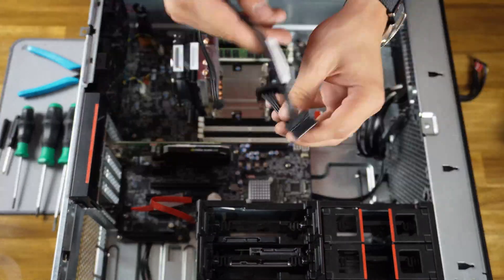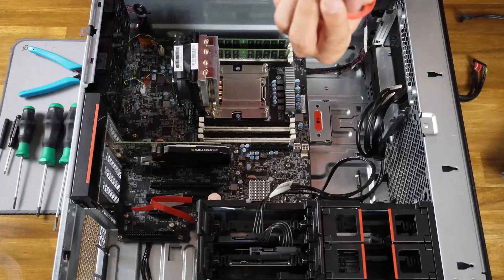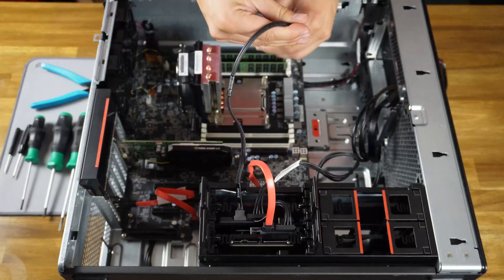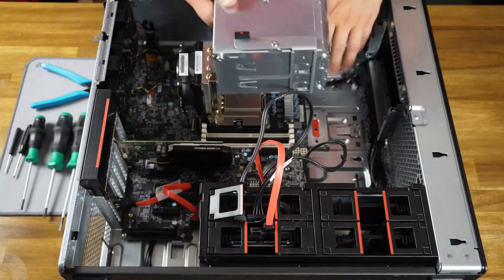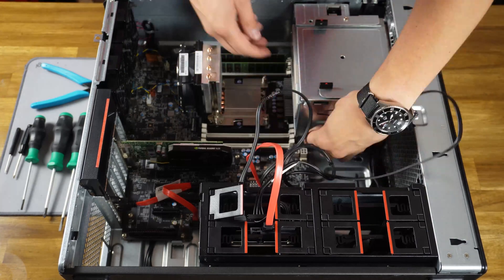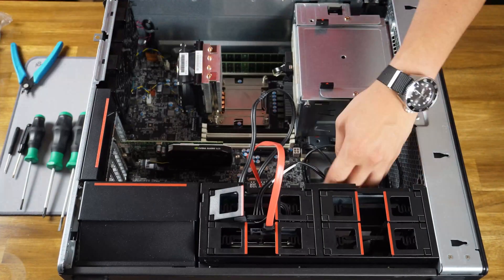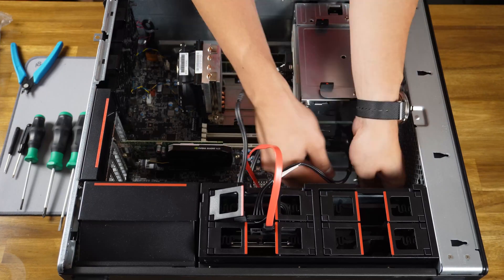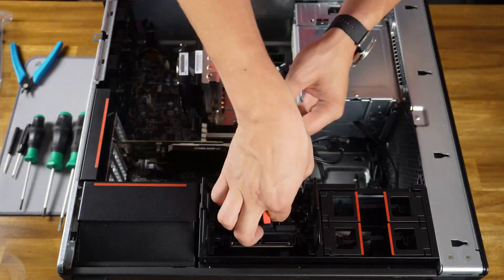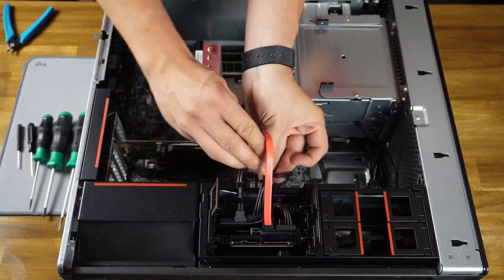These drive bays are great because they are tool-less, but what I don't like about them is that they have no cable management solution, so the cables are essentially staying out of the base and there is no other way to route them as far as I can see. I reinstalled the optical drive bay, the optical drive and the front I/O cables so that all cables are routed and I can start cable management. I also reinstalled the power supply. The power supply is 80 Plus Gold 480 watts and it's cableless. Next I spent ages trying to cable manage the SATA cables and I made a mistake so I needed to rearrange the drives so that the lid can close.